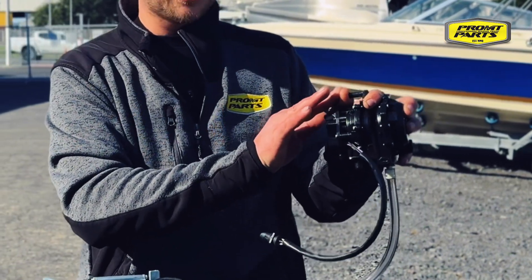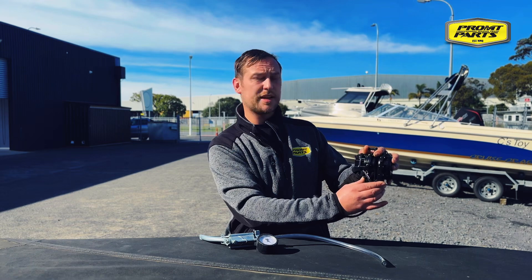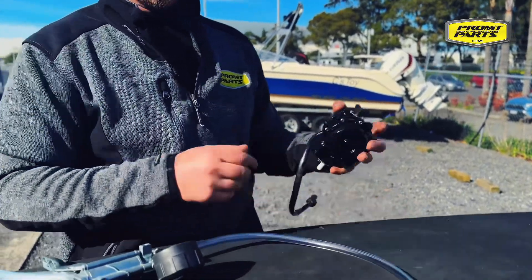It needs quite a lot of pressure, so make sure you do push quite tight. Rapidly release the pressure off the bottom of the pump. Did the pump click? No. So that means we go to the next step, which is removing the thumb off the top of the pump. Did the pump click? Yes. So that passed that particular stage of the test.